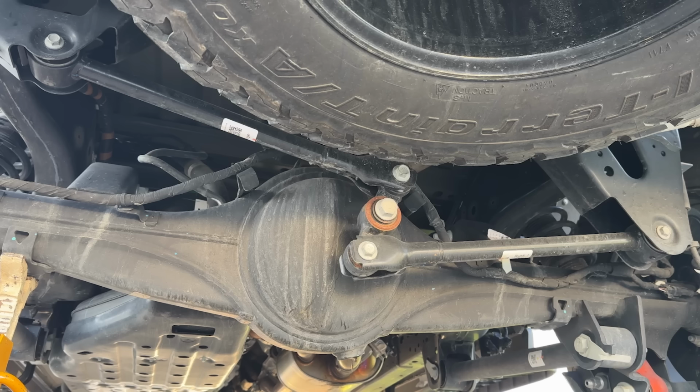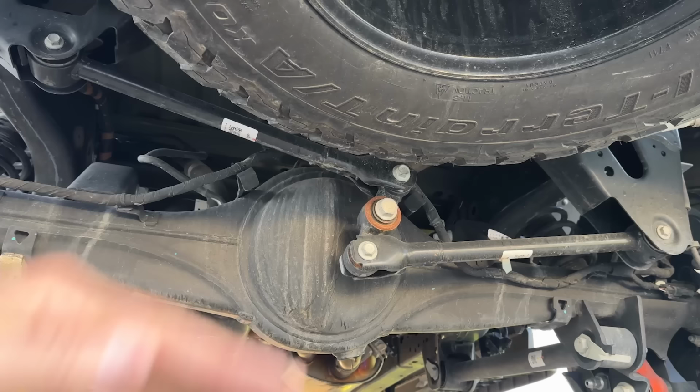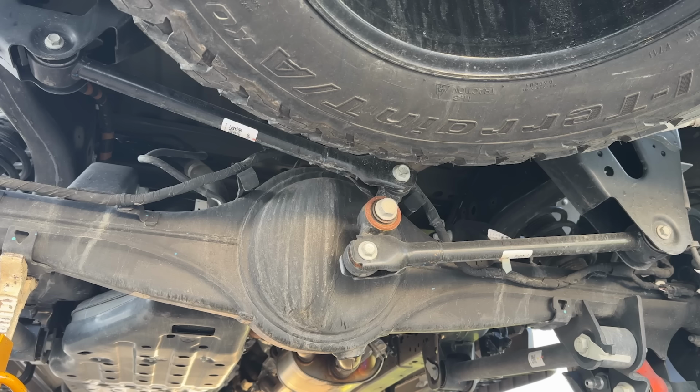But certainly, there's huge advantages to this. The axle goes straight up and down through its travel. It doesn't translate left or right. Cornering loads are very, very well braced with this setup. And they're symmetrical left and right. Any body roll during cornering does not create any asymmetry like a Panhard rod can do. So yeah, this is like on paper, way better, but in execution, it's more complicated and costly. But once you bought the truck, you don't care.